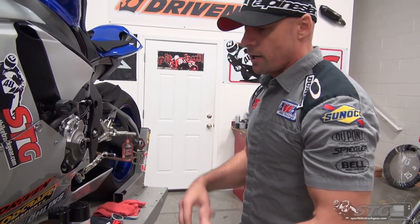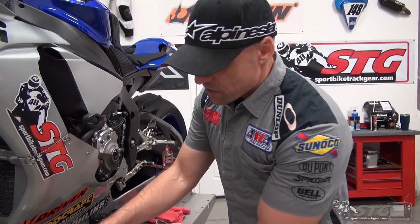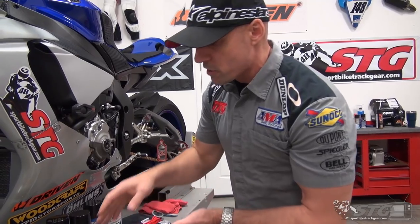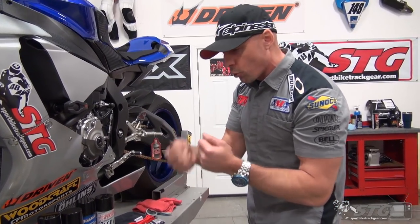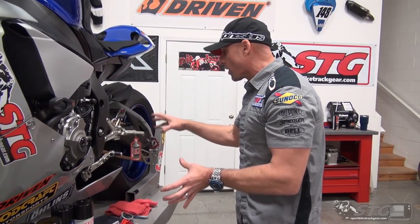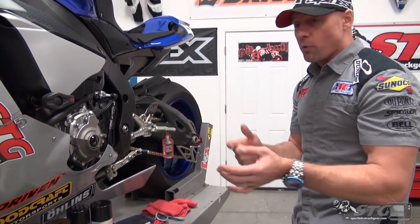So this is actually an important maintenance item, plus the bike's going to look super bitchin'. If you've got a gold chain, a black chain — anything but that stock chain — you're going to want to be able to see it, and I think this is the right choice. They have a second kit that is chain wax based — that's the thicker, whiter option. You're going to lose some of the sparkle on the chain and collect more lube on the sprocket. If you're a high mileage rider, like our guy Corey with 12,000 miles already this year on his Beamer, the chain wax is more appropriate.